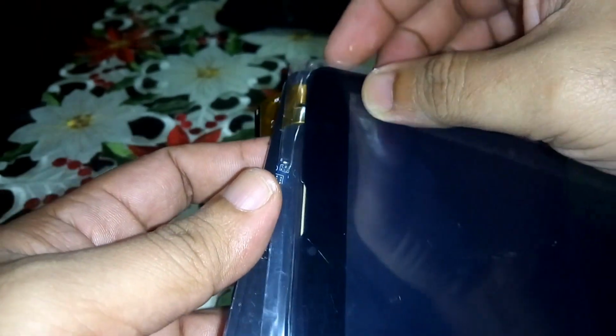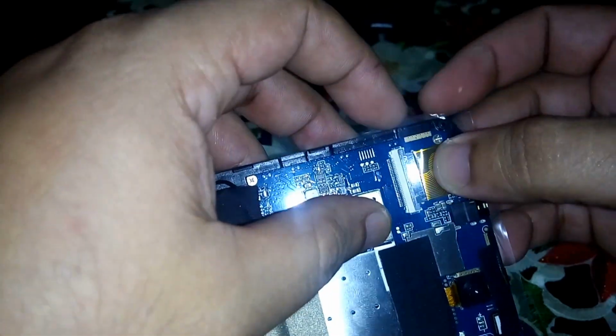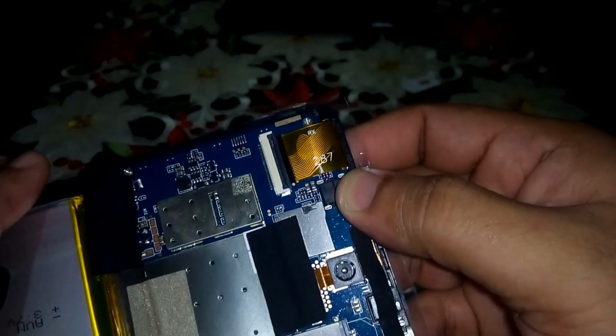I have to snake through this connector here. So we'll just place it here and put this on the connector hole. Test it out. See if this works. So be careful not to damage anything, especially the new digitizer. So it locks up. It's locked now. Let's see.